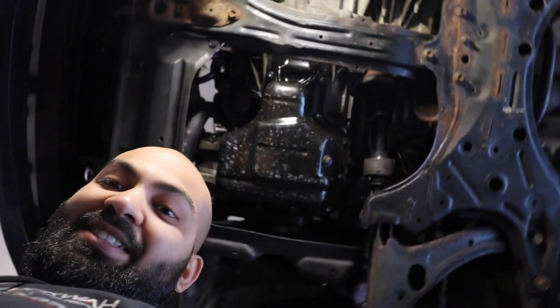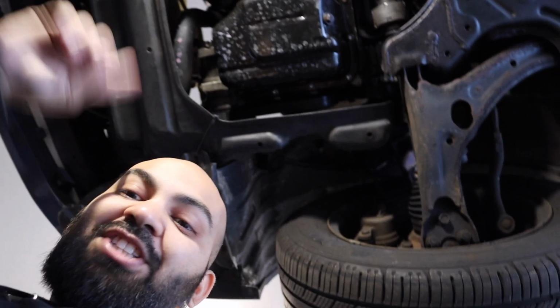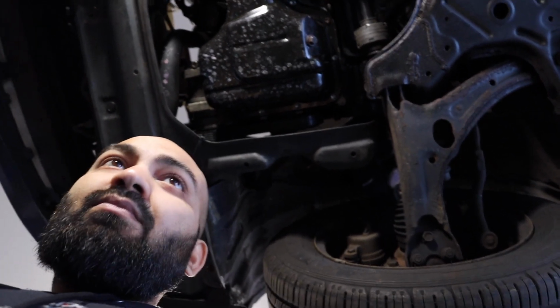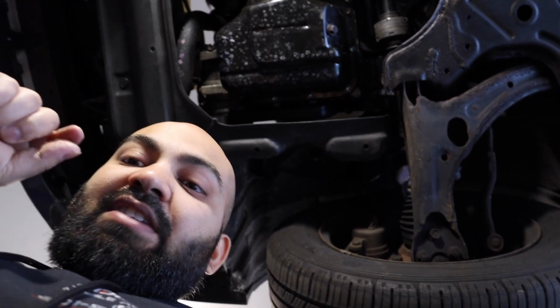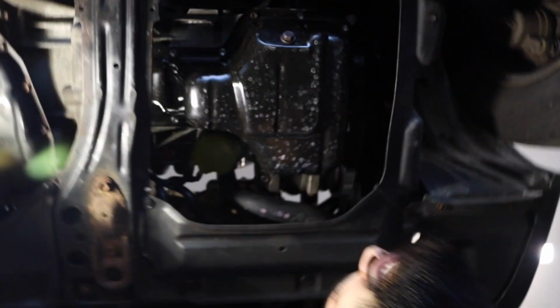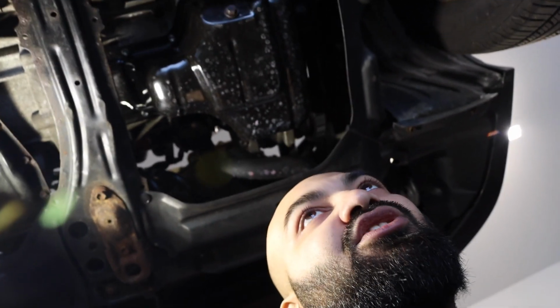It is amazing. Before, what made us rebuild this motor was some seepage by the exhaust manifold, by the head area there. I think the valve seals were going bad and causing it to leak oil out through the intake and exhaust ports. So we ended up replacing that, and while I had that off, my dad was like, you know what, let's just do an entire rebuild.